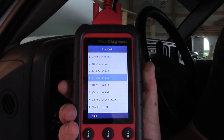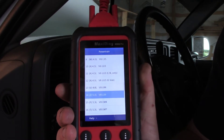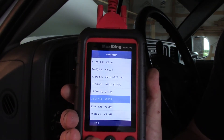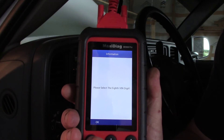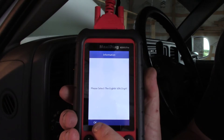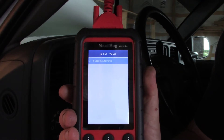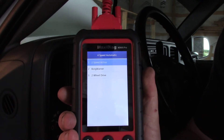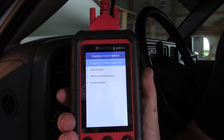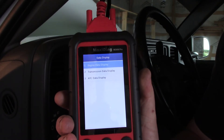We've got to go down and select the engine. This is a 5.3Z motor. One of the things I'll point out is when you get to this screen, sometimes it asks you for what the VIN number is. If you push the help button, it will tell you to please select the eighth VIN digit. So that is always something to look out for — if you don't know what the tool is asking for, make sure you click that help button. So this is a Z motor, we're going to select Z. Four-speed automatic, and it's going to ask about the transfer case — this is a two-speed active. We're going to go into the control module and look at data display, engine data.